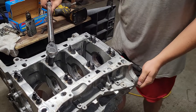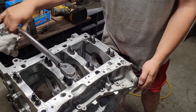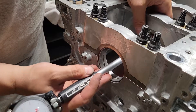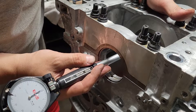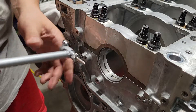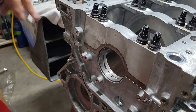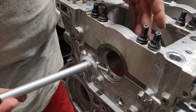Come back and check them — make sure they're all holding. We're good to go. Let's see if I can get it where the camera can see. The factory tolerance calls for around 1.5 to 2 thousandths clearance. Right around 1.5 — something like that. You can check the same way — 12 and 6, then 3 and 9, and go from there. Same thing on all of these — about one and a half thousandths, roughly.